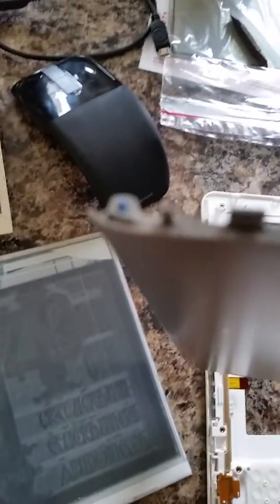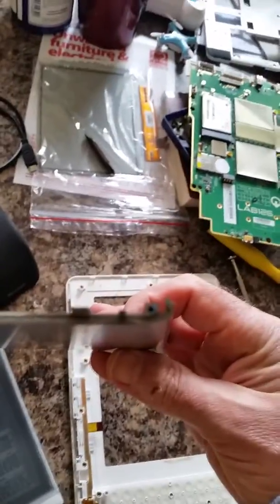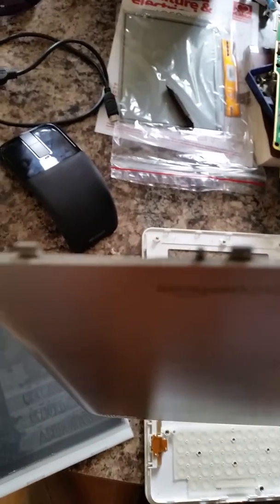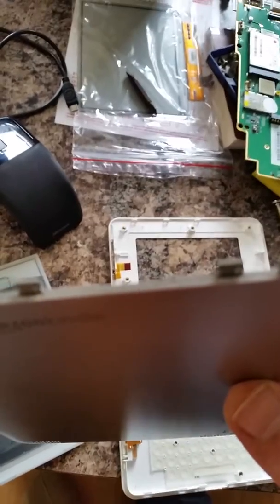At first it looked hard to remove this back plate — you can see there's a back plate here. You have to release two screws on the end: a screw here and a screw on the very end there. Take those two screws out. Again you push down on this plate and these little lugs on the end — there are three lugs — they're in receptacles in the holder that holds the main PCB. You just push down on them, then push the whole thing backwards, putting a bit of pressure down and pushing back, and then this will just come away.